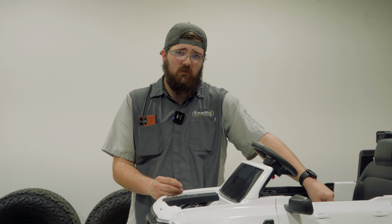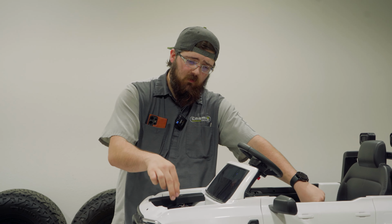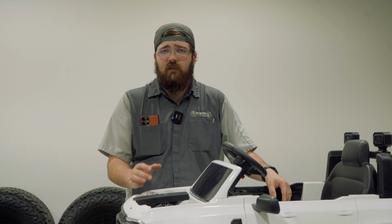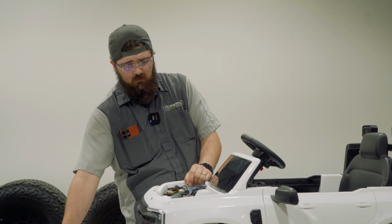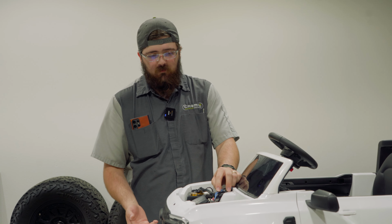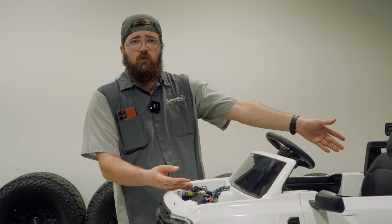So we have one underneath the seat from factory, from when you bought the car. And then I added 2 more here, here, and then underneath this plate back here. So he's got plenty of reserve. And then underneath this, I can pop it out. I've got the little Triton 250.2. It's 250 watts at 2 channels, bridged at 4 ohms, so it's 250 watts to those 2 little speakers back there.